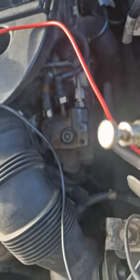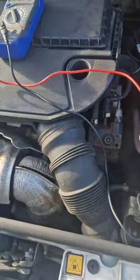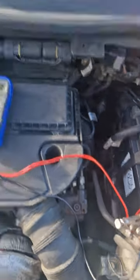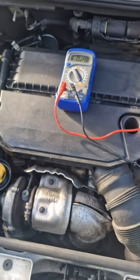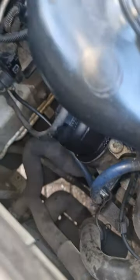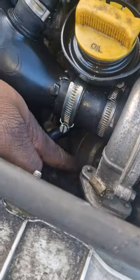That's your fuel pump. This fuel pump's in a really poor position, because it means the engine has to spin really fast to start. It's driven off the crank and camshaft. So you'd probably never be able to push start this car, I'm telling you, it's really hard to do. Up here is your engine ECU, and here we can see that this 280 milliamps is not dropping. Down here you've got your engine oil filter. This one here is probably the turbo pressure solenoid valve. As you can see, the hose is running back up to the wastegate, which is the turbo wastegate down here.